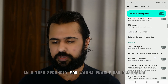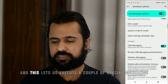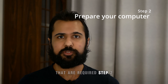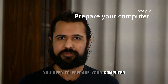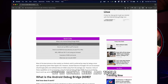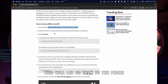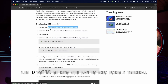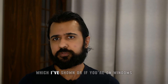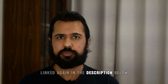Secondly, you want to enable USB debugging, because we'll be connecting your phone to your computer, and this lets us execute a couple of special commands that are required. Step two: you need to prepare your computer. We're going to need ADB tools, which is a set of tools that Android provides for developers — this will let us talk to the phone. If you're on a Mac you can use a terminal, or if you're on Windows there is a setup file linked in the description below.